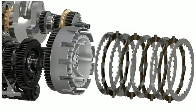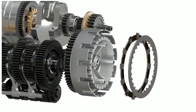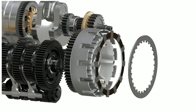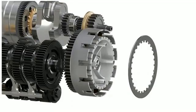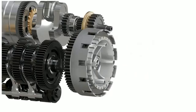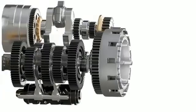To eliminate this problem, the clutch pack is used in place of the hypothetical connector. Unlike the hypothetical connector, the clutch pack is a combination of separate circular plates. The friction plate has teeth on its outer circumference that always interlock with the clutch basket and can slide sideways along it. The steel plate has teeth on its inner portion that always interlock with the grooves in the inner hub and can also slide sideways along the hub.